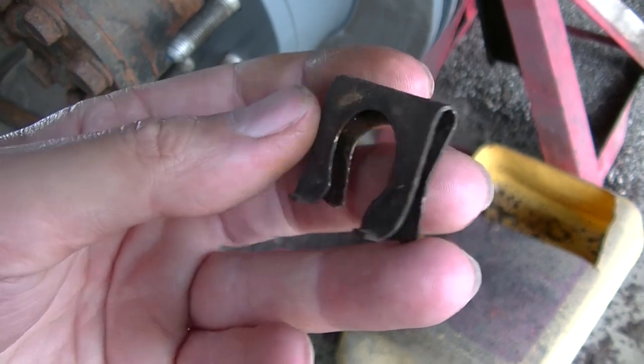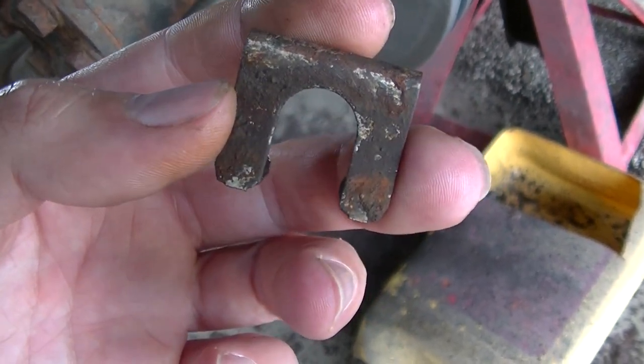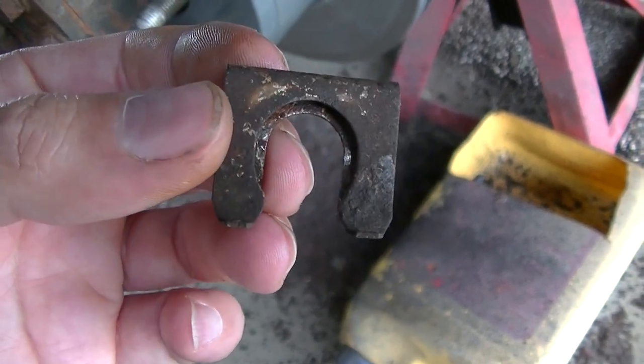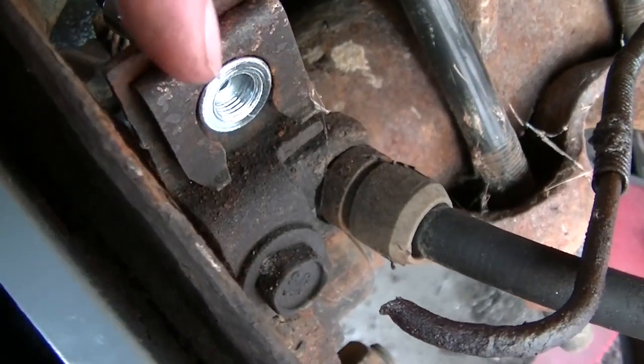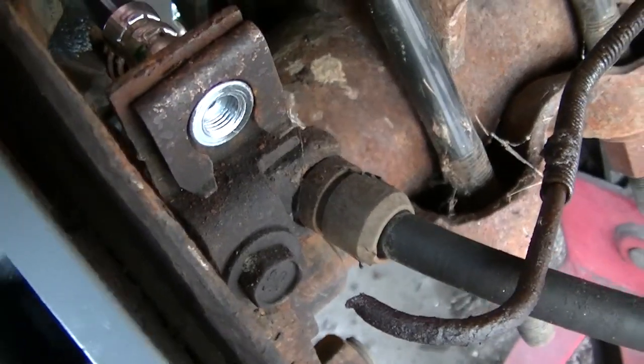When installing the clips for the hoses, you can see there's a flat style and then there's a round part. That round part is for the actual brake line side — you can see how it fits the contour of it. The new stainless line should be fairly easy since it's all pre-bent. You are going to have some brackets holding the old line in place, and obviously you're going to have to take it off the brake hose and the T-fitting going to the other side.